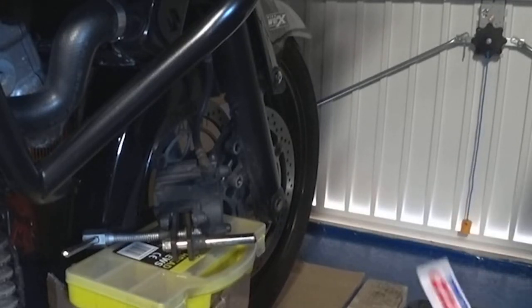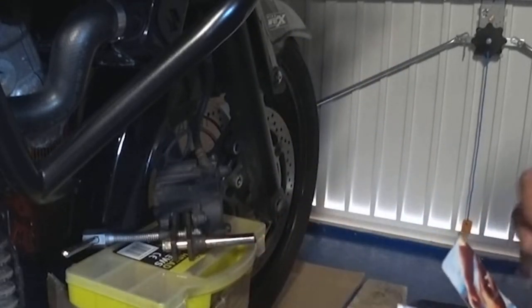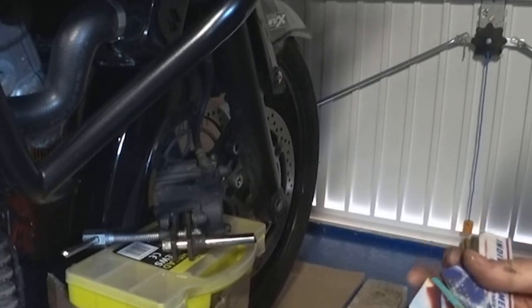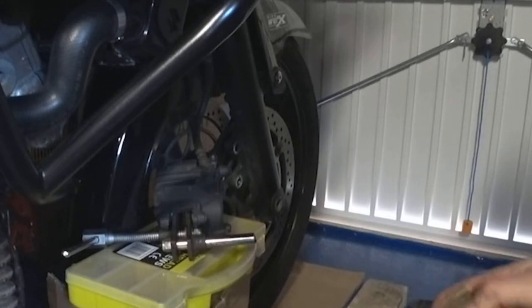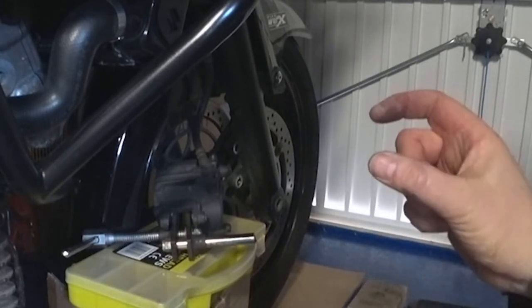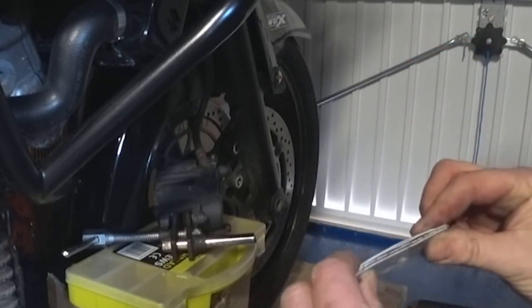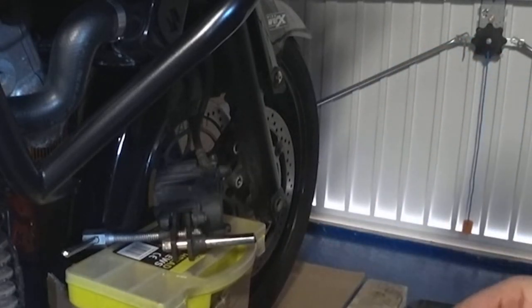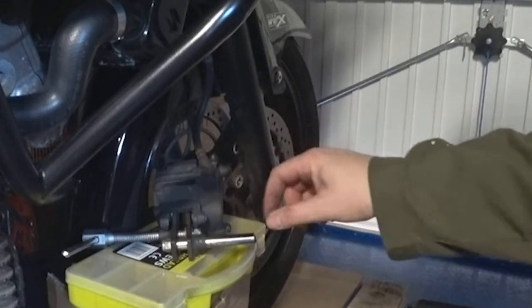Just as an aside - these are the things I use as shims from Costco wholesale. If I want my brake caliper pistons most of the way out, I've got thinner wedges of wood so I can work out how far I want the piston to come out. Slot them in and push the piston out to them. Just peel these out one by one as it becomes loose. There's a bit of wood between the pistons and the housings, which is nice and gentle and doesn't damage the caliper.